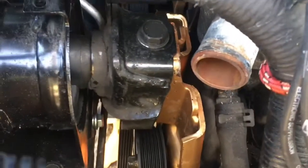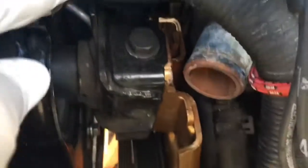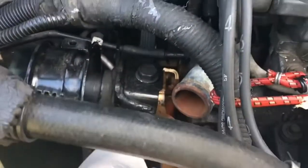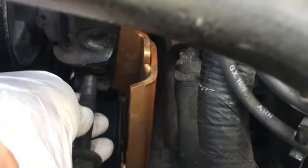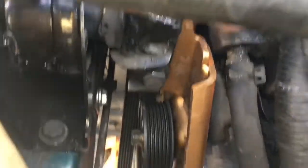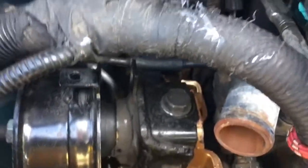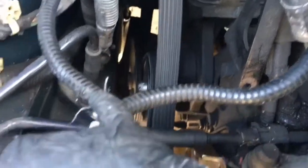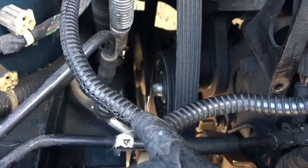Here's something strange — going after a possible engineering problem. Unlike my O5, this has one bolt on top. The O5 has three bolts across the top and no cross bolt. This cross bolt is pretty low. I'd hate to leave just one bolt up there, because if that breaks, it could cause the engine to drop and the steering unit would hit the bottom of the frame — and that would be bad.